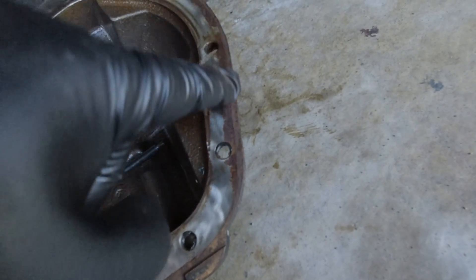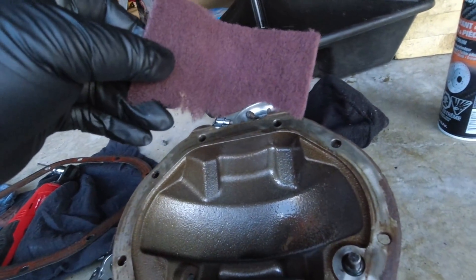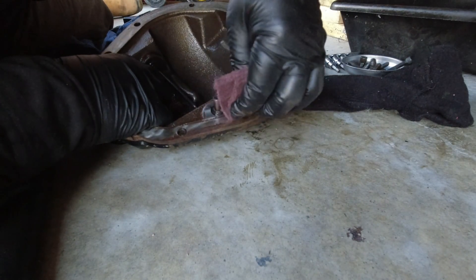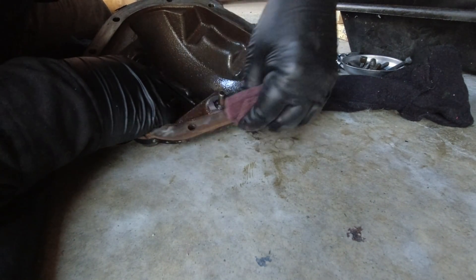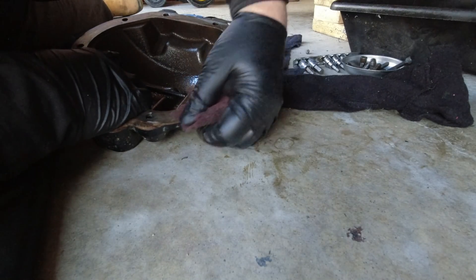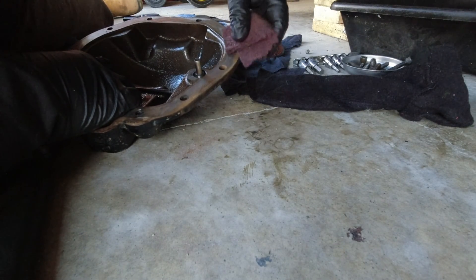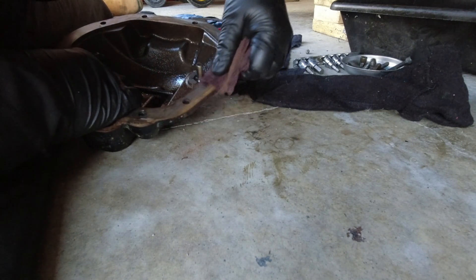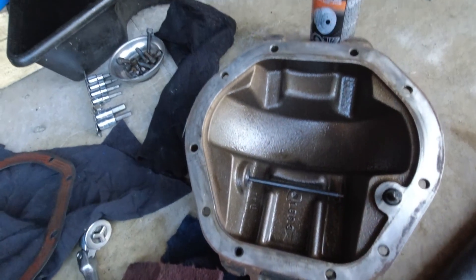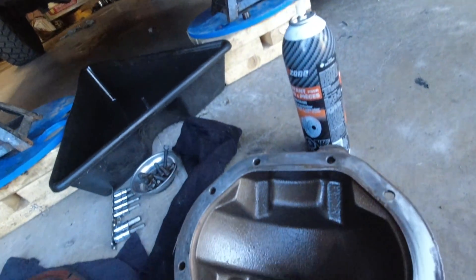I was having a seeping issue with this one, but it's not because of the gasket itself - it's because of all that rust on the bottom which is preventing a seal. I just used some scotch brite on the bottom there to clean it up. What it's doing is taking off all the high spots - the high spots are what's going to cause it to leak. There you have it - it's going to be night and day difference when it comes to making a seal. That seepage problem should definitely be over with now.